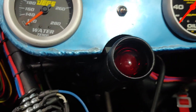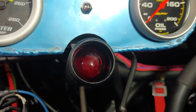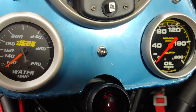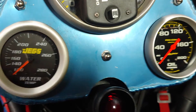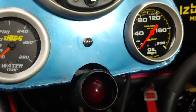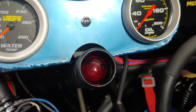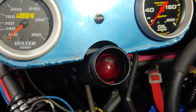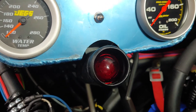With this you also have to hook up the low oil pressure warning light. There are two simple screws in the back of the oil pressure sending unit that's installed onto the oil pressure gauge — those have to be connected. Simply put, if the oil pressure falls below — in this case I have 15 pounds — this light will illuminate telling me that I'm out of oil pressure or very low, and I need to stop before I blow things up.